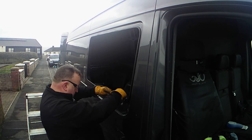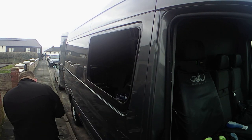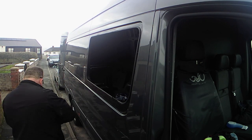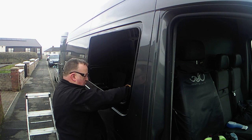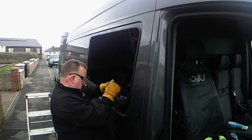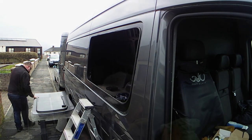You also need to etch the painted area on the back side of your window — this will need primer as well, and this will give a good solid surface for your sealant to stick to. This is a sacrificial trim that I'll remove later. It just makes life easier — to be honest, if you have any mishaps or get sealant on your trim, it's coming out anyway. So it just makes a tidy job.